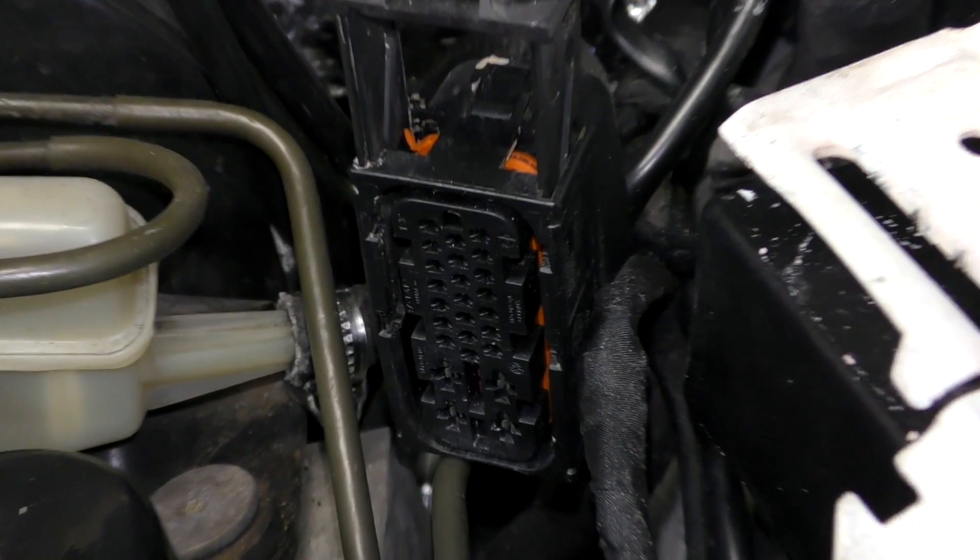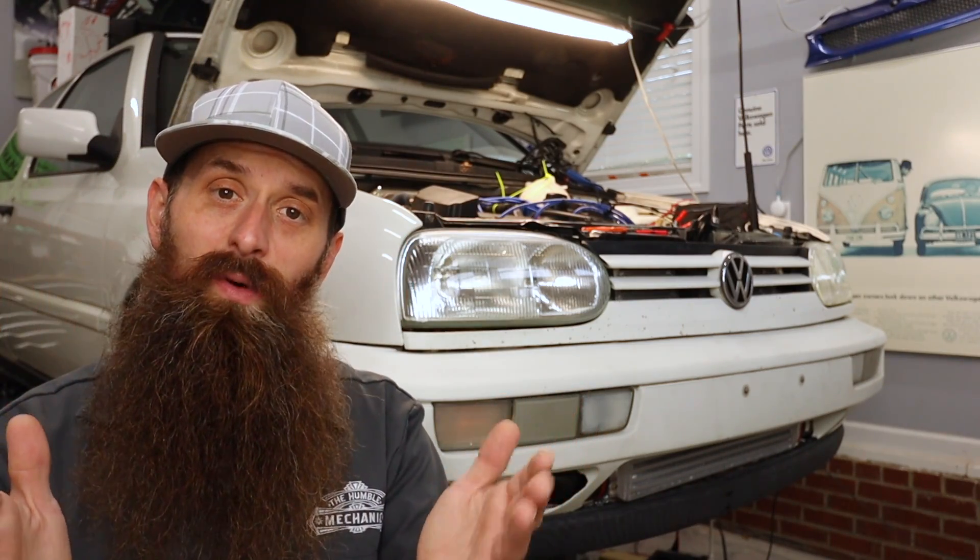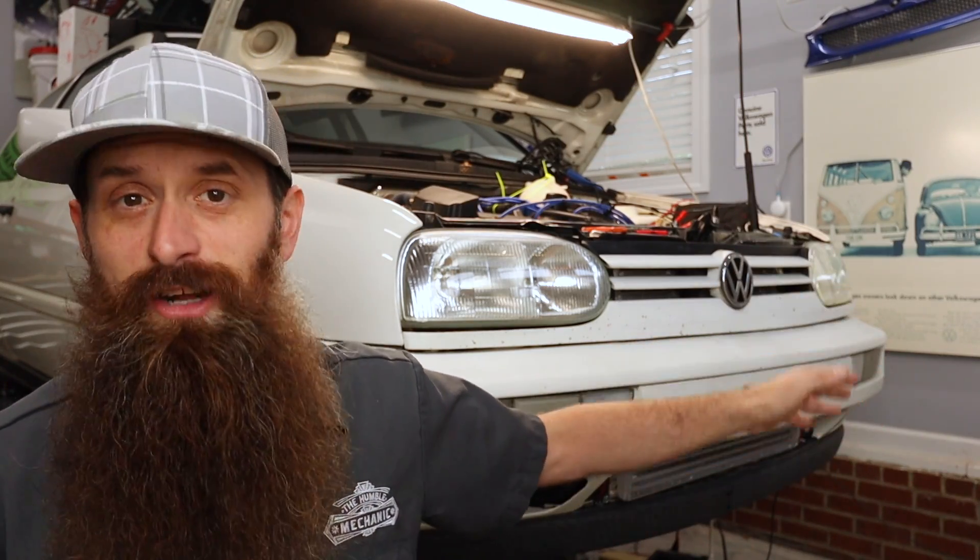Next step was a quick visual inspection — the sensors are there, the wiring looks good. I went ahead and disconnected the ABS module and cleaned that connection out. It was a little bit gross inside, a tiny bit of corrosion, but I don't think enough to have caused no readings at all. After cleaning that connection up as best I could, I plugged it back in and went back into the measured value blocks, spun each wheel by hand, and found that now I got speed from both front wheels — I could see the actual numbers change when I spun the front wheels.